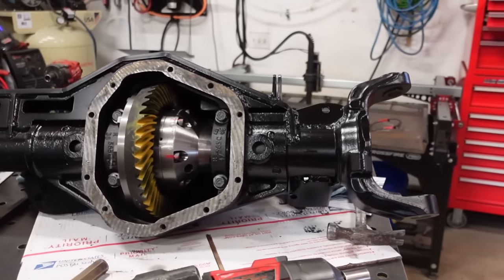Well, guys, I figured I would save you from the boringness of pulling this thing back apart a million times. After I put the new race in and the new front pinion bearing, everything tightened way back up. Now the pinion depth stayed the same, but the pinion preload was insanely tight. So I had to pull that apart like 4 or 5 more times. Finally got this thing dialed in.